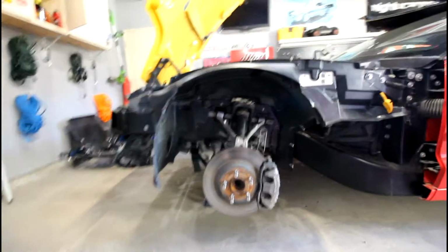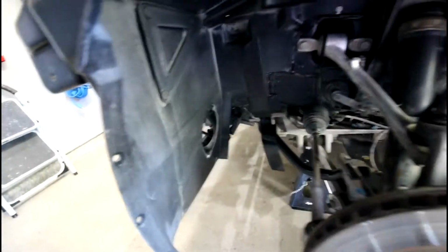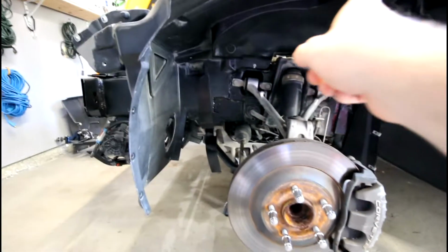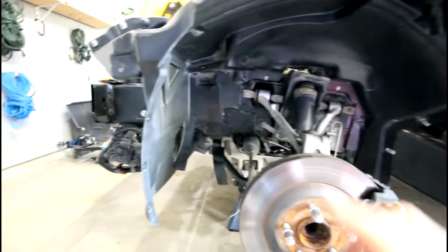And then what I did was I basically took the panel bond with the mixing nozzle. This helps because you have a really precise nozzle, and I just deposited all of the glue in all the gaps where the glue goes. So in the front here, all along the back here, all up in here, on the back here, and try to get it down in there and also down in here. And then I took a bunch of different rubber gloves and used my finger and just spread it nice and thin, smoothed it out to make it look as nice and as factory as possible.